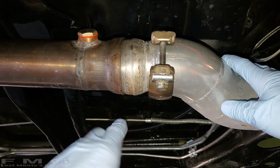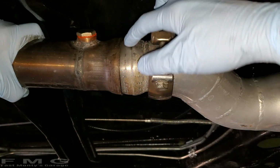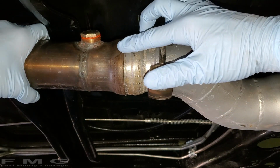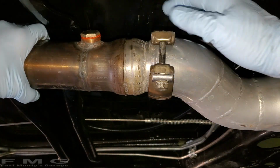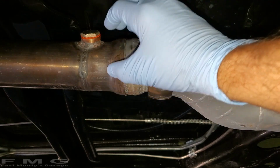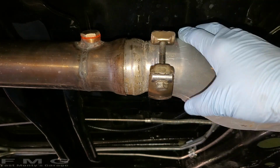Alright team, my plan is, if you can see, I backed off this exhaust pipe so we have a gap. I'm going to put a bead, probably 3/16 inch diameter, all the way around. And then I'm going to move the pipe onto it like that. And then add more, or spread it out with my infamous tool, which is your finger. And then I'll put the clamp over it, finger tight the clamp, and then wait about 45 minutes, and then torque it down to about 22 pound-feet.